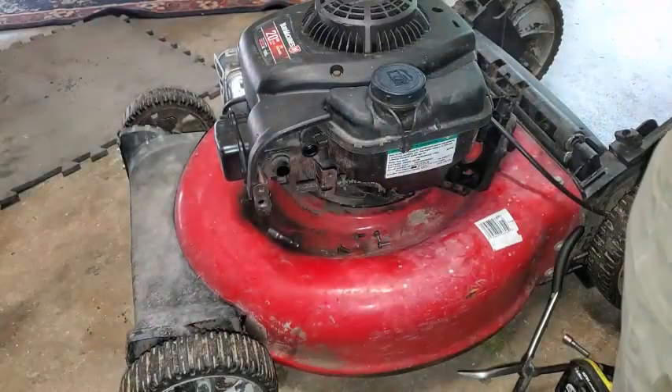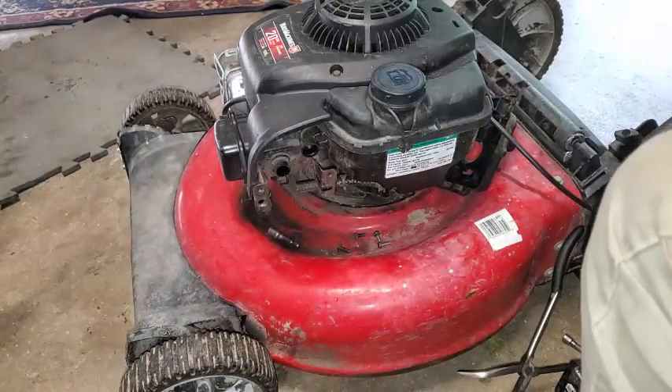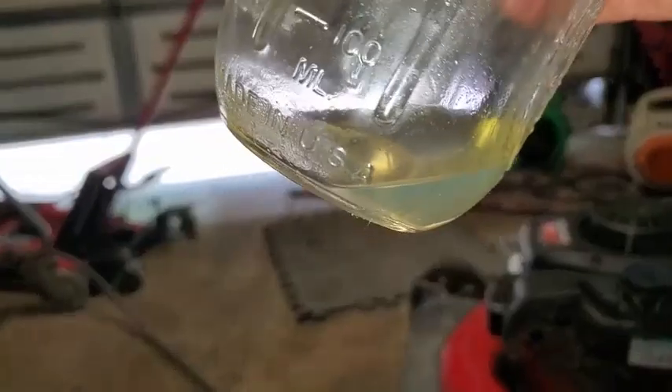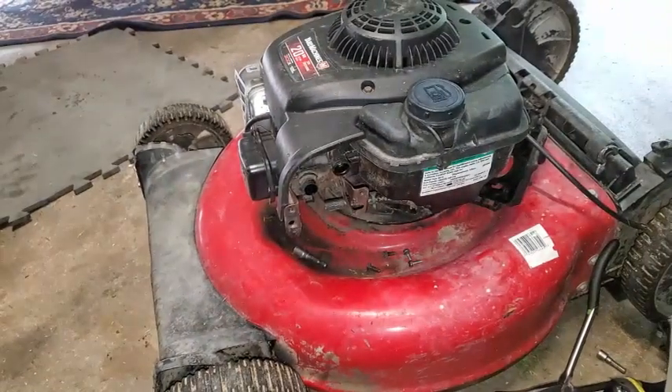Here's the gas — you can just put it kind of sideways like this. It's kind of hard to see at this angle, but I can tell that there is water in there. Do you see that line going across the bottom? That's water that's just in the carburetor. At the very bottom there's a little bit of water. So what we'll do is dump this out.